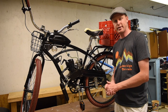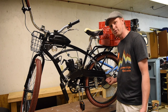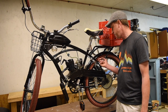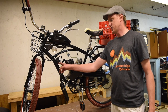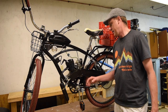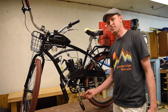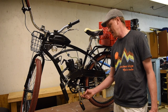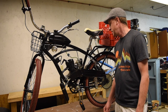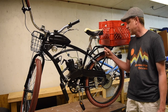Overall this was a pretty easy project to put together. I think it took me about a day and a half, and that's because I dinked around with the rear sprocket — I initially put it on backwards and the chain was rubbing on my wheel a little bit so the rubber tire was wearing down. One thing I would recommend is buying a bunch of zip ties so you can zip all your cables down and they're not touching the engine block. Because of the added weight of the engine, the kickstand is not very happy with the bike now. That might be my next investment — to buy a more heavy-duty kickstand so the bike doesn't fall down. Right now I'm just leaning it against objects or sticking it in the tire rack when I park it.